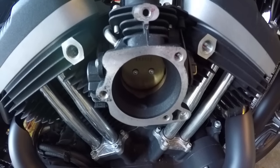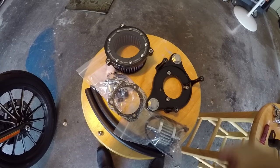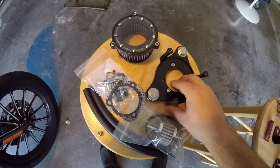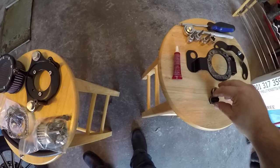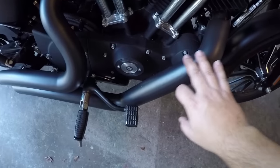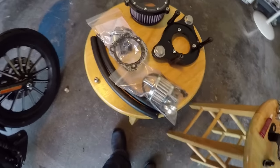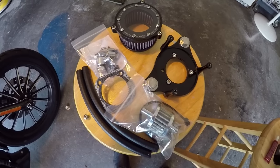This is where it's going to pretty much divert paths depending on which air cleaner system you've got. I've got a kind of hybrid, weird thing I put together — I've got this air cleaner which says Figure Machine, bought it off eBay, which has a solid backing plate. I also have a bracket from DK Customs. I previously had the external breather bolts from DK Customs, but those were putting a lot of blow-by on the side of the bike, getting on the exhaust and the oil tank. So I'm going with a different external breather system using hoses and a filter, which should keep that from happening.